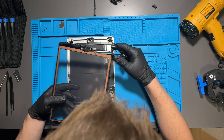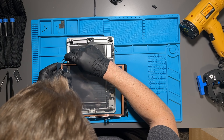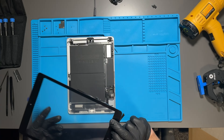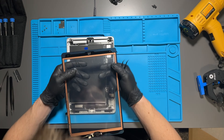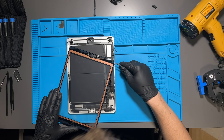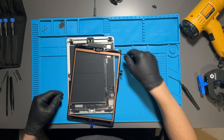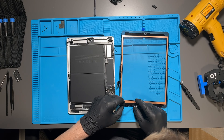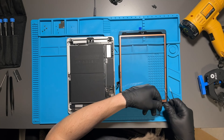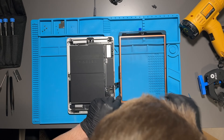There is a protective film on the underside of the replacement screen. I kept trying to pry at the corners and kept hitting the little copper wires around the edge. I didn't damage the front glass, but I confirmed there is a protective film — I finally found it down in the corner and was able to pry it off. Make sure you remove that before reattaching the LCD. The ribbon cables also have little adhesives on them — remove those and position the cables correctly.